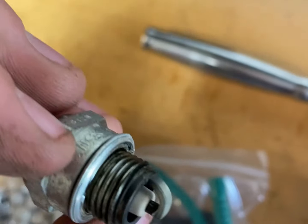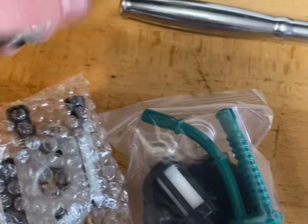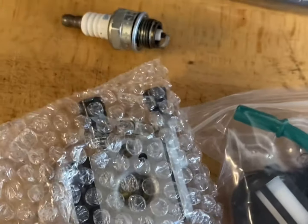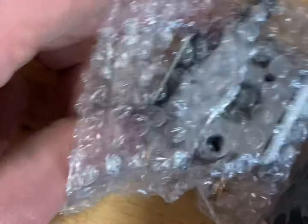It's got a bit of carbon on there — it was probably running a bit rich actually. But your elevation changes all that. This could have been running down at sea level, or it could have been running at 8,000 feet and now I'm at 5,000. It'll kind of compensate for itself almost. And as far as I know you can't really jet one of these carburetors.